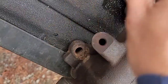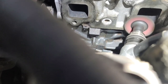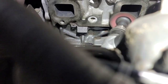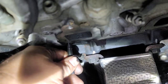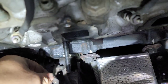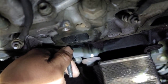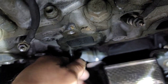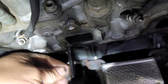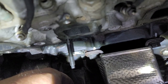I had figured these two right here would be the worst two, and they seem to have cleaned up the best. Trying to keep the video shorter, I didn't show the whole cleanup process, but I cleaned all my mating surfaces and all the threads on every hole that was threaded. So I went ahead and put a couple of studs in. I'm going to put four in so I have a guide to set the manifold up on and something to rest the gasket on. I believe these studs are longer than factory — I'm going to measure those out. I do know the factory ones took a 5.5mm hex head, and these take a 5mm head to tighten them up.